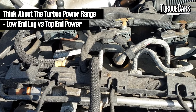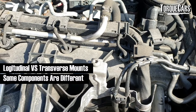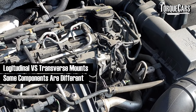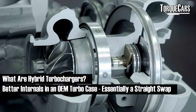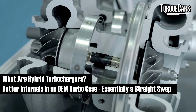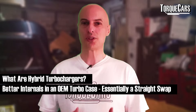Watch out that you have the correct turbo orientation. Passats, A4s and larger cars generally had longitudinally mounted engines, whereas smaller cars like A3s and Golfs had transversely mounted engines, with differences in the plumbing going into the turbo. It's easy to get caught out buying a turbo for a 2 litre TDI that's the wrong orientation — you just need to change a few ancillary parts to make it fit. A hybrid turbo takes a standard VAG turbo casing and swaps out the internal components for more preferential flow rates, with a generally larger compressor wheel to optimise the power profile.